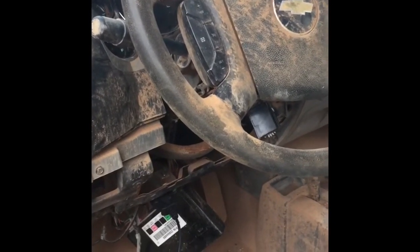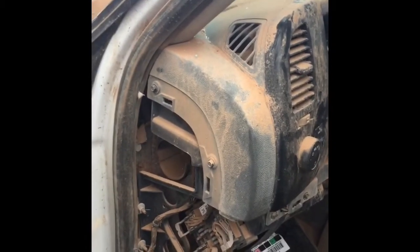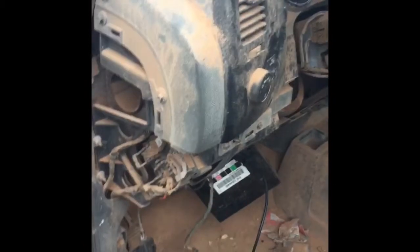That's really, I think, what stumped me on the last thing. I checked every connection about 7 or 8 times, ohmed everything out, just chased wires, and I really think that all it was, was the programming to the new glow plug control module. But there it is. Sorry, I'm going to talk and just stand here showing you an ugly, nasty dash, and the truck ain't all that pretty anyway to look at.